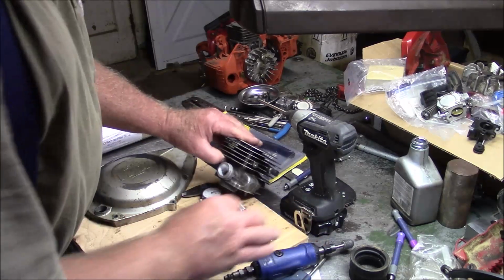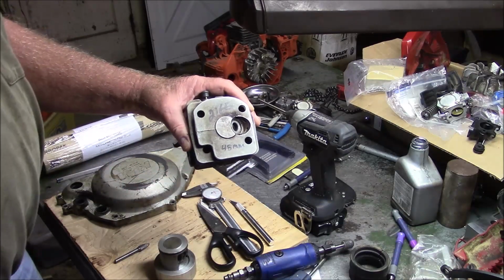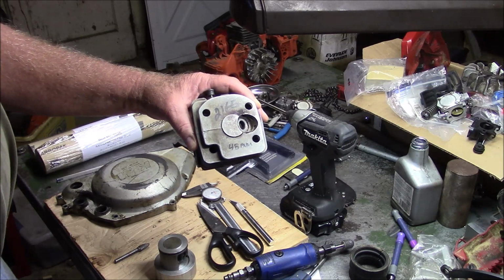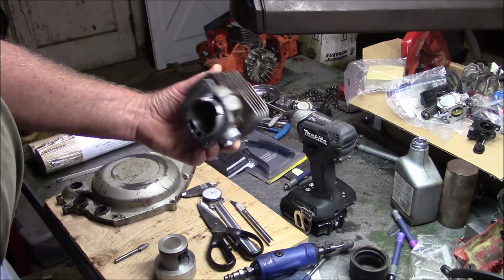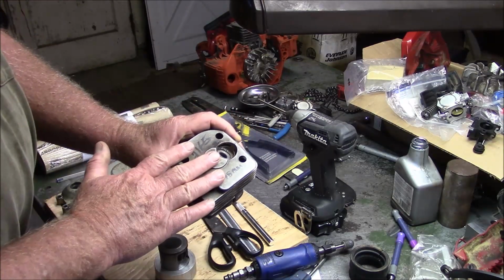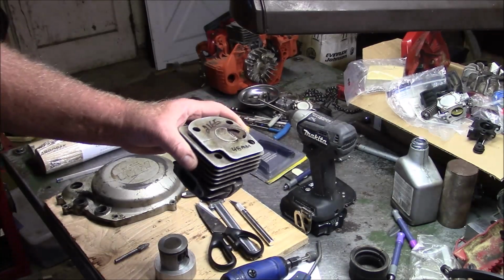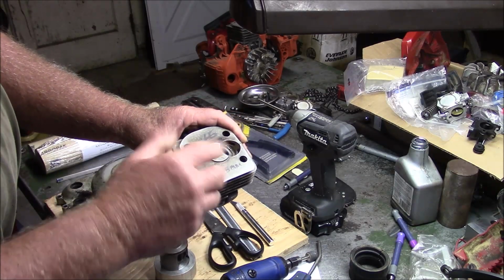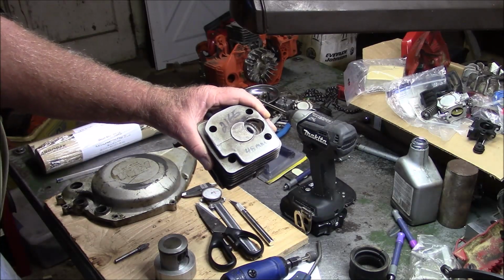So net, I'm looking to get this 48 millimeter, which a lot of guys toss away, which was the beginning of this whole discussion. And why would you throw away a perfectly good OEM cylinder, which is going to outlast any aftermarket out there by orders of magnitude? Why throw it away? So with some very simple changes that you can do with tools from Lowe's, the original premise of the channel, I believe, and I think we're going to prove, that these 48 millimeter cylinders tweaked just right can actually outperform the stock 50 millimeter saws.